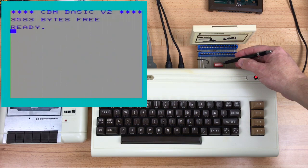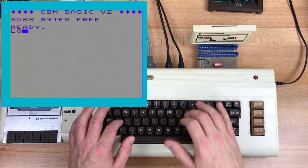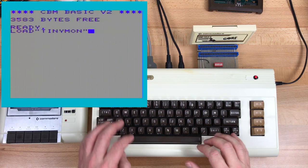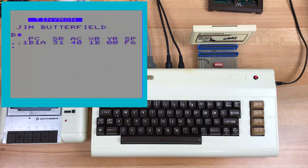And then if I switch this back on again, the computer can now see that cartridge again. Now I need to load a machine language monitor. If you have VICMon, that sits in block 3, so you can use that. But for now I'm just going to use TinyMon, since that sits in the basic 3K of RAM. Now we just need to issue the save command to save the block 5 address range, which is A000 to BFFF.